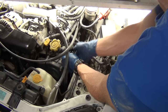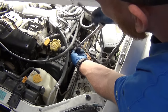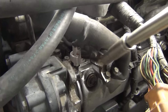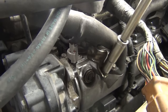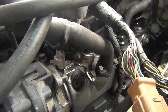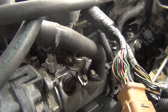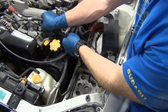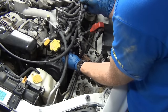Ideally you just want a new O-ring but I couldn't find one and my valve gasket kit didn't come with one, so you do the next best thing you can - which is gasket maker. This thing can take a lot of weight if you have the bracket in there where it's supposed to be. You can see this one's been snapped off right there - the plastic is broken. I'm going to line that up the best I can so it still has some support and bolt it back in place. I'll need to pick up a new filler neck with a new O-ring when I get the chance. As I tighten this down it looks like it's going to be okay - they wiggle together so there's some strength there till I get a new one. This goes into the AC compressor and clicks onto the filler neck.